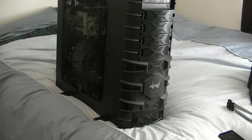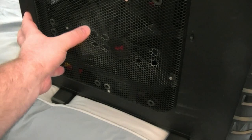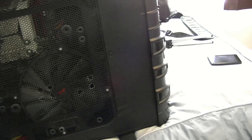I used to have the Antec 1200, which was about this same size. It had three fans right here, all with filters for intake, then a 120mm fan with a filter for intake, a big 200mm fan up top for exhaust, and two 120mm fans for exhaust as well. The filters were really nice on the Antec 1200 — they really helped keep the dust out. I had to clean the filters about once a week, since I pretty much keep my computer on all the time.